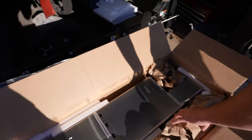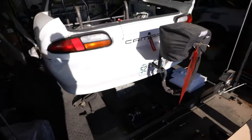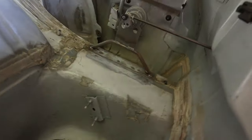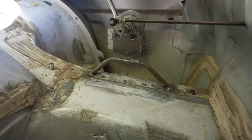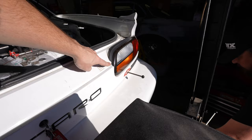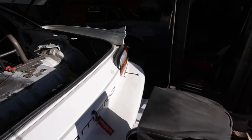The welding looks good. The biggest thing is I need to see where the new battery tray sits and consider it in comparison to where my shut-off is, so that'll probably have to get cut out and laid in there, and then I'll have to remount that. I'm gonna have a hole in the car, but we'll figure it out.